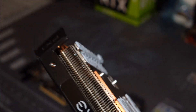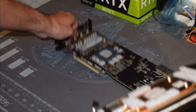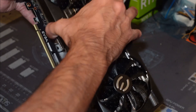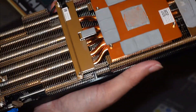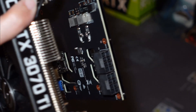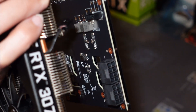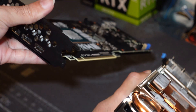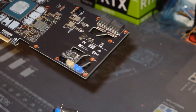On the inductor it looks like 1 mm. Once you have all the screws off, you're pulling from the IO side and very carefully pulling up. Because of how hot this thing got, it gave us some problems. As you're pulling up, you'll have two connectors in the way: the LED connector right in front of you, and then the three fan connectors. I got my finger in there, popped that LED connector off, rotated it so they're side by side, and was able to undo the three fan connectors. Now it's just a matter of cleaning up — I'll do that off camera.